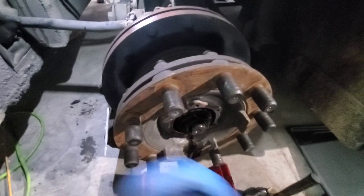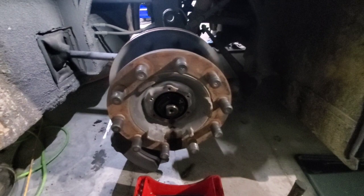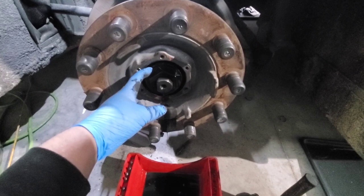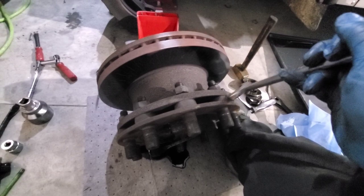I do have an adapter — one of the bars that comes in and adapts back to use with an impact — that definitely hits and gets stuck. I gave up on a ratchet pretty soon after because I was only able to get the nut up to about here before I couldn't get my ratchet back. So just like anything else, we're going to bend this tab out of the way, take the lock nut off, take the retaining ring and the locking for the rear one out. I've got the spanner wrench, take out the rear nut, take the outer bearing off, and we're just going to slide this entire hub off.